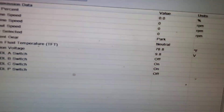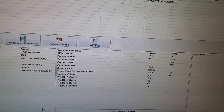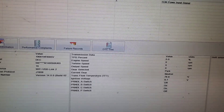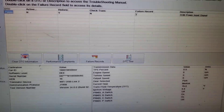As you can see, I'm hooked up to my TCM and I'm getting 9.8 volts, and the battery has 12 volts. The loss in voltage here is causing the TCM to shut down and drop our speedometer off.